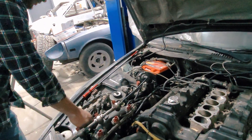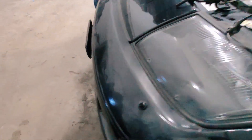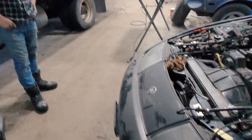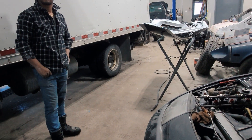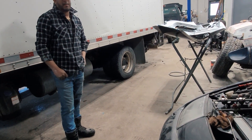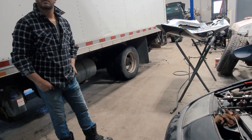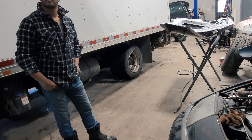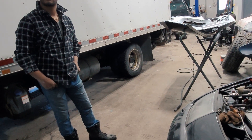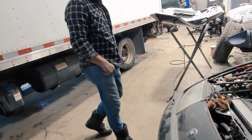There's also aftermarket boost control on it. The windshield washer nozzles are relocated on top of the intercoolers so they spray on top of them. It actually does make a big difference — when I'm driving, I do a couple of squirts and the boost hits differently; you feel it. Then it dies away as it warms up again, so you've got to squirt it again.